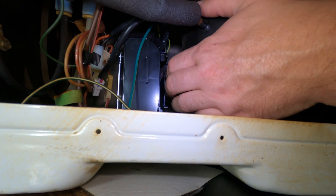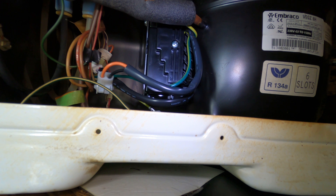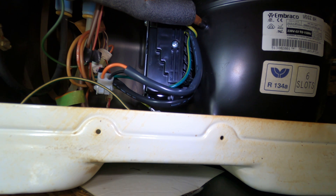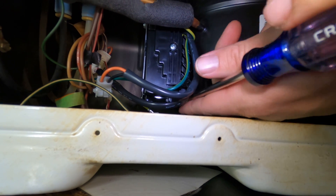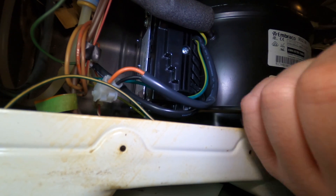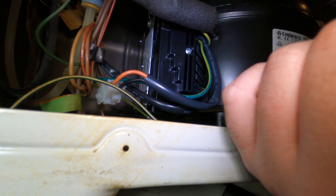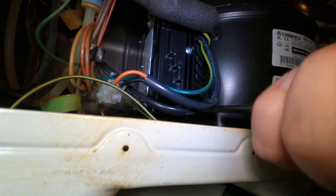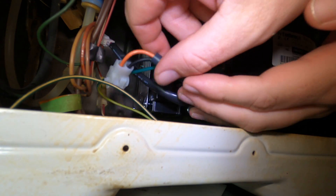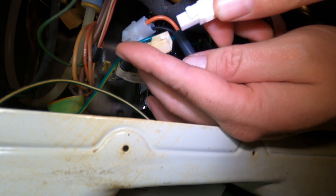There's still a chance you'll need a compressor — putting compressors in these refrigerators is not cheap. I typically charge upwards of a thousand dollars to do one, and I dedicate the whole day to it. A lot of companies can do it in two to three hours, but sealed system work is my weakness and I make sure it's done right. I've had situations where I'd solder something and get called back a couple days later for a small leak. That's why I charge what I do.